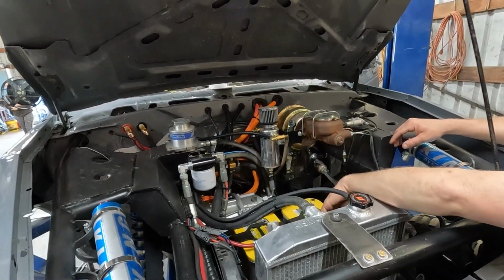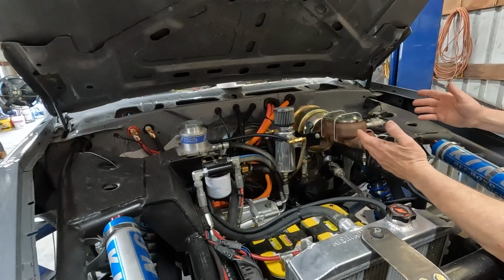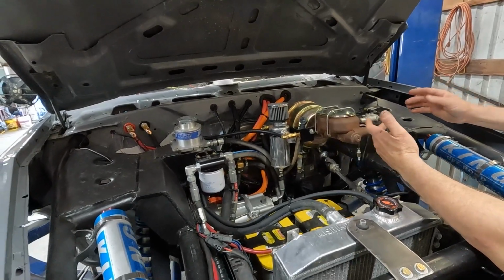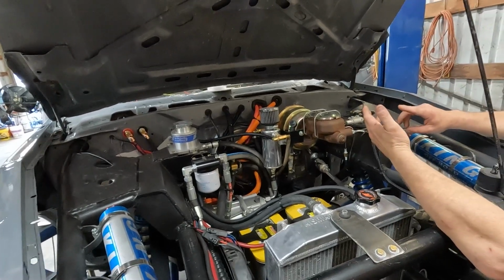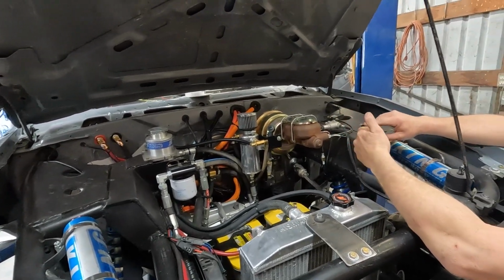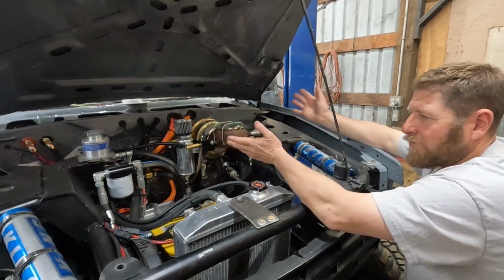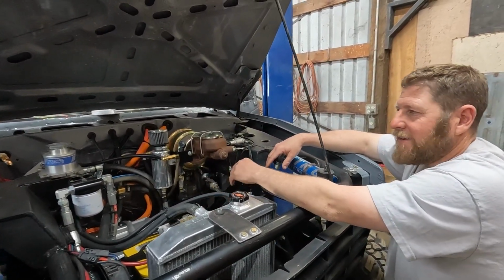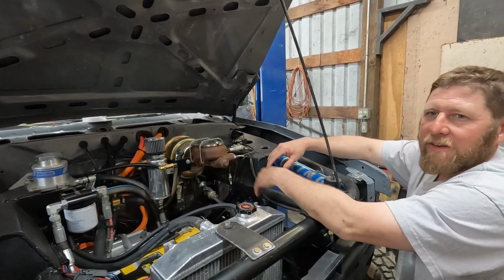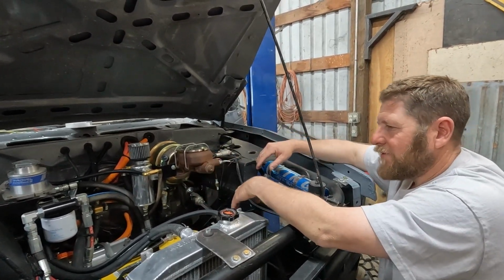You got 2 12-volt batteries. Okay. Because we do have a lot running on 12 volt. I mean, the vacuum pump for the brakes, the vacuum pump for our helmets, all of our comms, our GPS, all of our lights, everything's all 12 volts. So we figured 2 batteries gives us a little front weight and takes the load off the DC-DC. Yeah. So you have more in reserve.